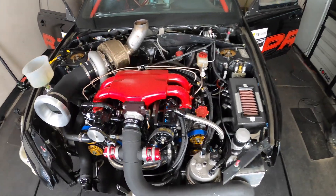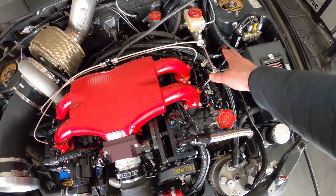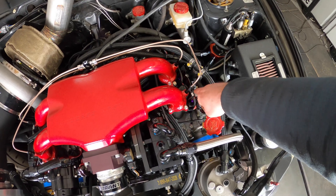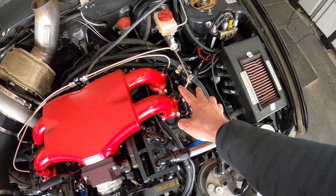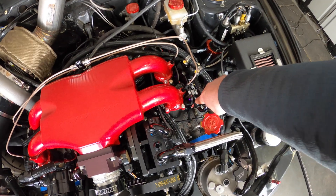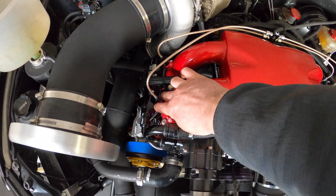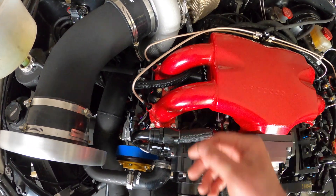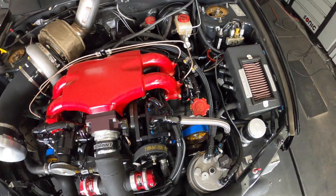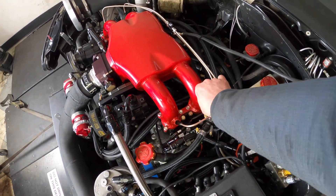This is a bad chicken. So what we did on this car since the last time — we now have nitrous on here, because why not? We had these ports. We decided to switch to the radium fuel rails. We had two sets of rails for our twin injector setup, so we went to a single rail for the twin injector. There are actually two injectors per cylinder. We figured why not just shove nitrous jets in there, so we have a dry shot of nitrous — on about a 50 shot currently if we decide to spray. We can obviously jet that up if we want bigger.